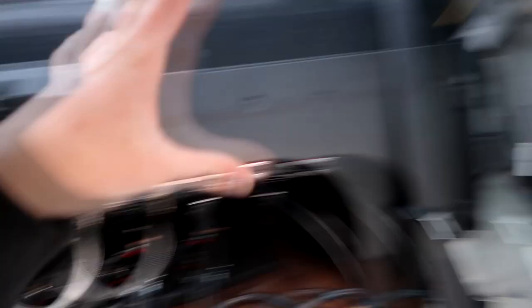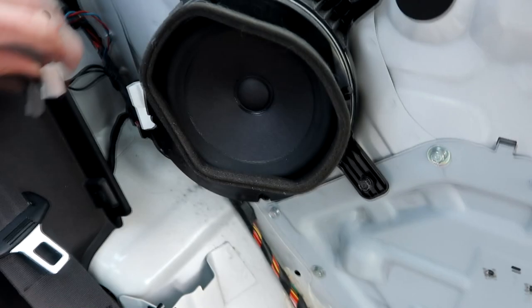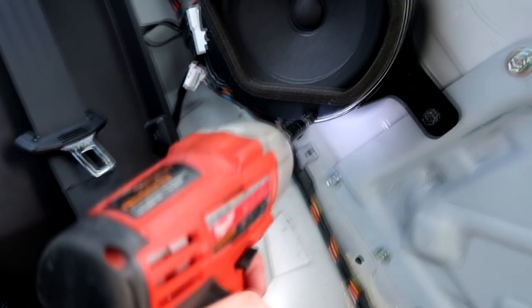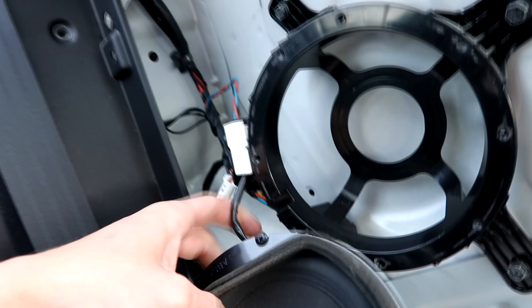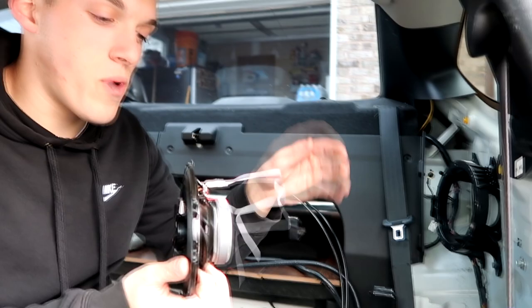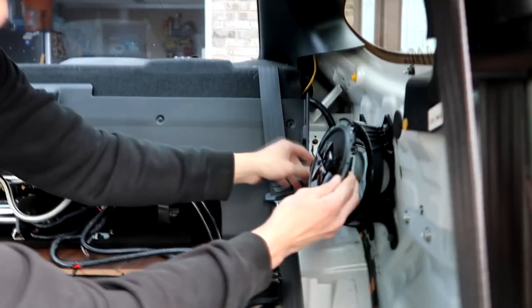Alright guys, now that we're in the back of the car, I have everything all removed. I already did this speaker — that's all done. Now I'm going to be showing you how to do it on this side. It's pretty much the same exact thing, it's just the wires are different colors. The first thing you're going to want to do is unplug this and throw it off to the side. Then you want to go ahead and take off the stock speaker from the stock basket. Now this should come right out — we're going to be using the stock basket here. I have my wires plugged into the back of the speaker, and now I'm going to run them right behind the basket. Then now that they're sitting back behind the basket, I'm going to go ahead and send these in with some self-tappers.